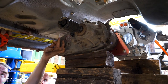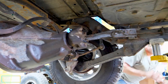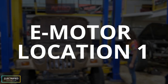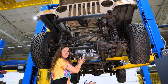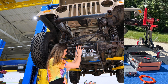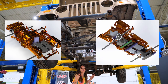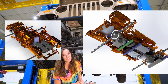There was lots of measuring and discussing, trying to figure out the right location — what we call Concept 1. One of the first real concepts where we thought this is the way to go is putting the electric motor a little bit more to the front, and then distributing the entire pack into a front pack, into two modules underneath the car, and one at the very back of the Jeep. With simulations and analysis, we thought the vehicle weight would be very evenly distributed with the battery modules laid out like that. That was our first concept.